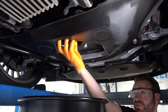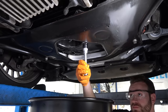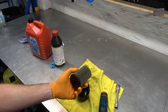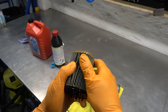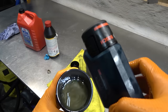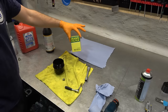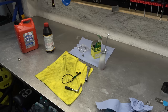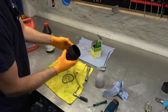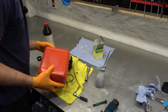Let's shut it down and drain the oil. We'll remove the cover tomorrow to check for oil leaks - for now we're just going to let the oil drain. Looks good. No shavings on the magnet - it's clean. The oil filter as well - no big chunks, just filtering some other crap. But there are no big metal chunks or glitter in the oil filter cap, which is to be expected during the breaking-in period. All looks good.